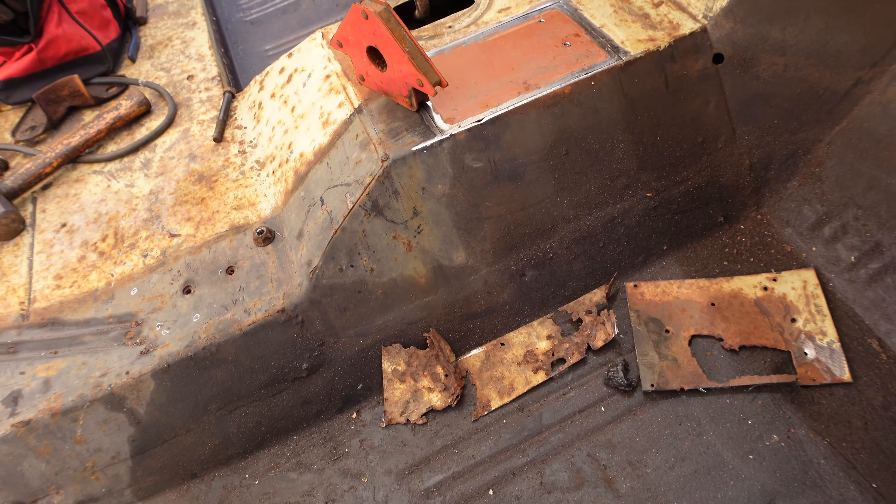The wires were getting tangled inside the welder. Anyway, it's finished for now — that's how it's gonna look. I'm gonna grind those weld spots down and then all the edges will get seam sealer. Then I'll get a bed truck coating and good to go — very solid.